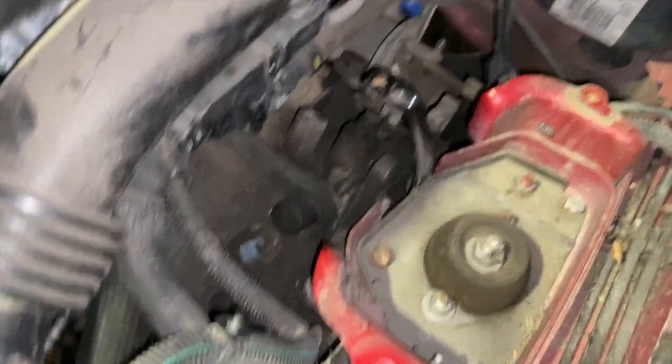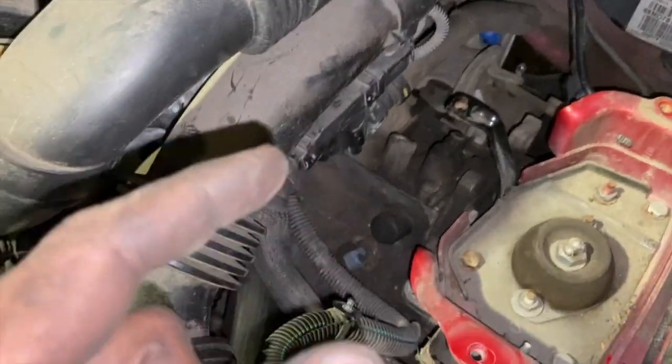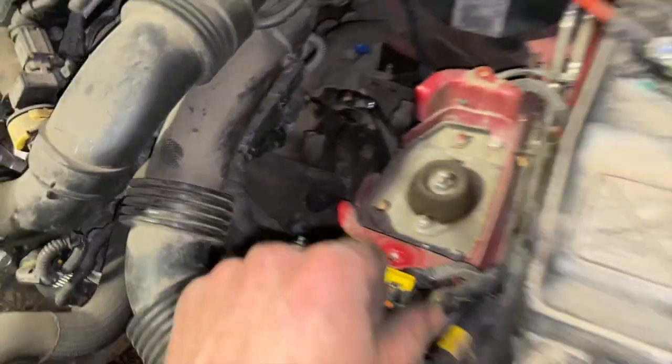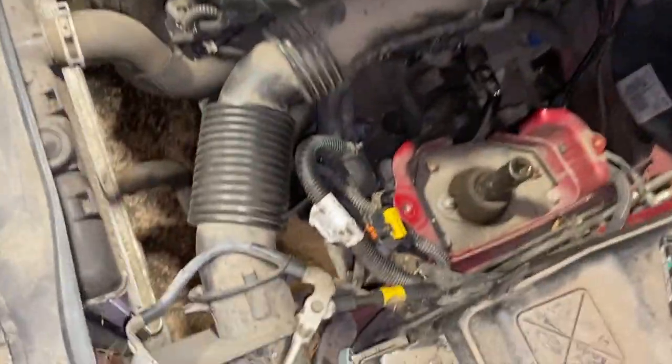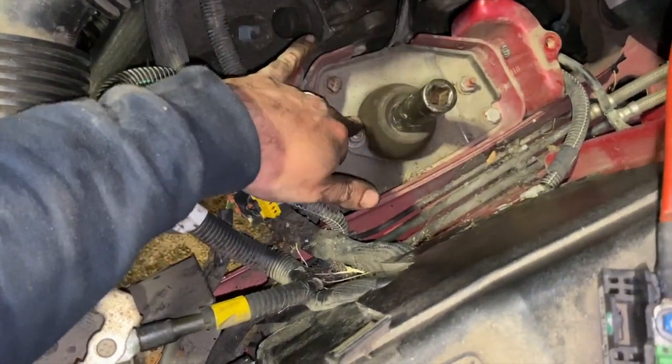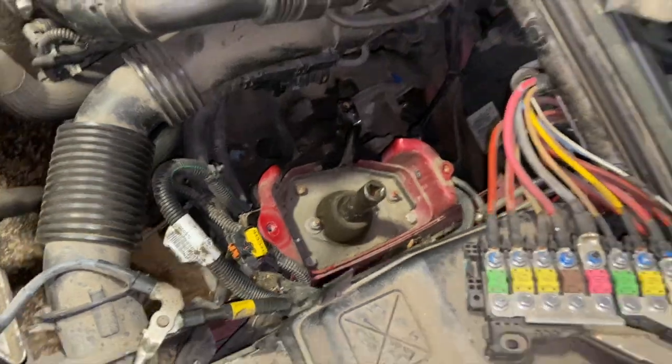Obviously as well, just undone that starter motor bolt, but I just have to pull the starter motor out slightly from the back as well. And because we're doing it up on the ramp, I'll just leave an 18mm socket ready for that, and a 13 so that we can come up on the ladder and drop that without messing about.